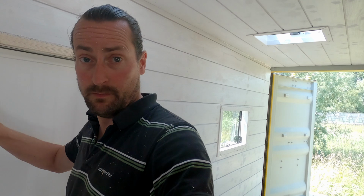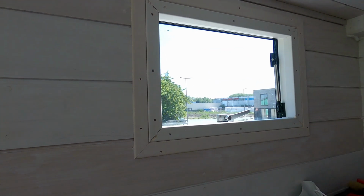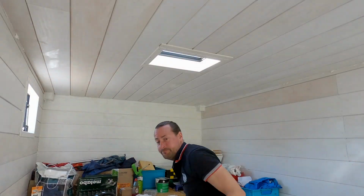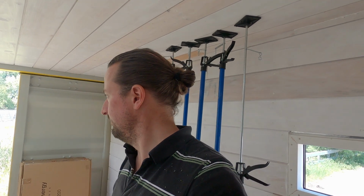And this does two things for me. One, it gives solid strength to the frame of the windows and the doors, because it needed that. And the second thing is that it filled the gaps without creating a cold bridge. So I think this is the right solution. I'm really happy about it. And then we finished everything off with this window framing, or I don't know how you call it in English. I'm really happy with it because it looks nice already. We still need to paint it, and on top of that we will place the window covering, the all-in-one curtains and mosquito net. So yeah, it looks good.